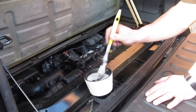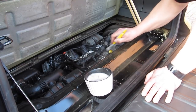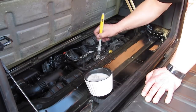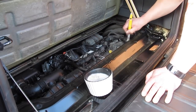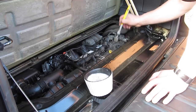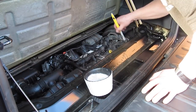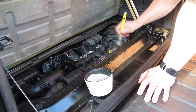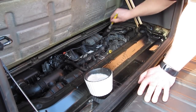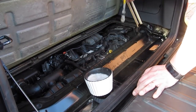I'm being really generous with it, moving on to the other side of the engine now — this is where you've got the alternator as well. All the while I'm doing this, I'm avoiding electrics if I can, not trying to force any down there. But I am giving it a bit of pressure, looking into all the nooks and crannies. I'm not being frightened of anything because I know the doggy poop bags we wrapped around the more sensitive electrical components are going to protect from any overspray or splashing. I'm working my way into the actual side of the bulkhead of the engine bay, being really quite aggressive, putting lots on. Remember, this is a 2008 car — about 10 years old — and this has never been done in this engine bay before, so it'll be quite interesting to see how it turns out.